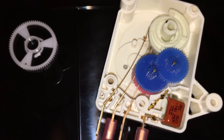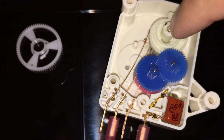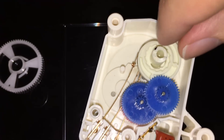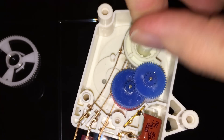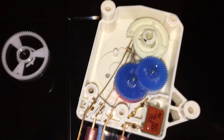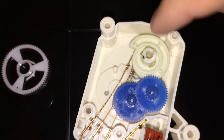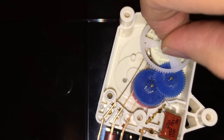This part is actually accessible through a hole in the case, so you can stick a screwdriver in and turn it manually to advance it into defrost if you want. Look around where your thermostat control is in your refrigerator — look underneath for a little circular hole with that kind of profile.